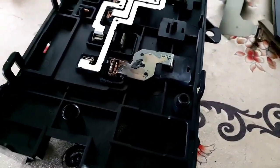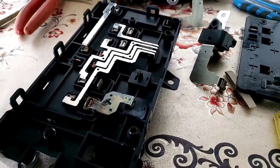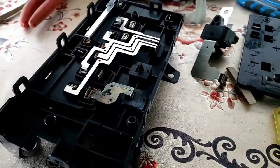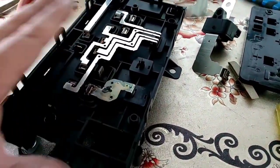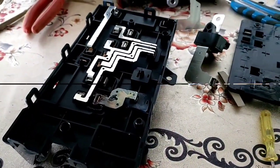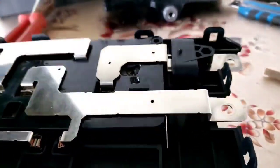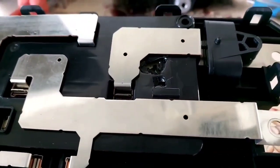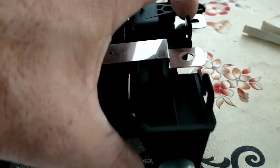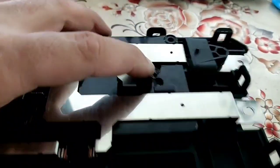What we're going to do is clean it up, put it back in, and see if we can make the vehicle at least start to take it back to the shop. The dealer is going to take care of this component and change it for free because it's a recall. I'm also testing the relay to find out why we're getting arcing and melting. Look what I found behind the cover of the negative contactor — completely melted. This is the main outlet, this component is the current sensor, and we have our negative contactor — completely melted.